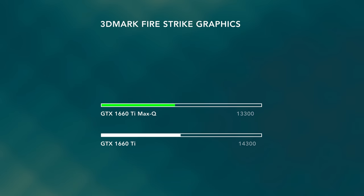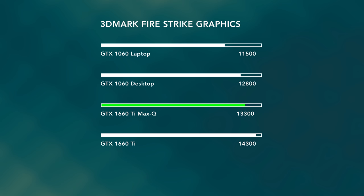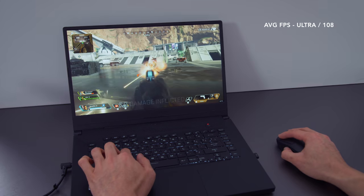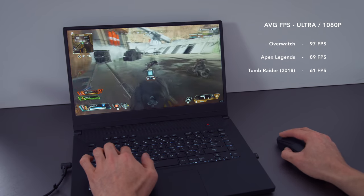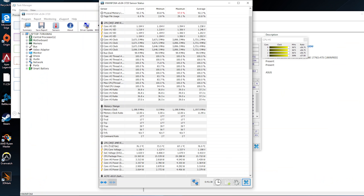The performance on this device is something most people are interested in. It's running the Ryzen 3750H and a GTX 1660 Ti Max-Q. This is where my expectations were also led astray — when they first announced this device, I thought it was running a regular 1660 Ti. It's actually running a lower wattage Max-Q version. It's faster than the GTX 1060 for laptops and desktops, but it's slower than last year's 1070 Max-Q. The thermals are fine — it doesn't overheat or throttle, which is impressive considering the thickness of this device.